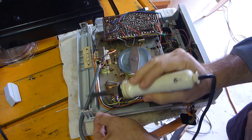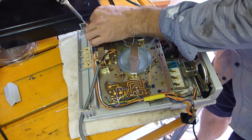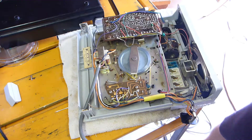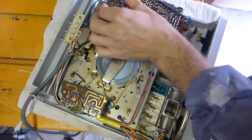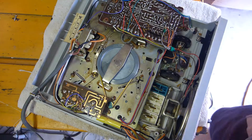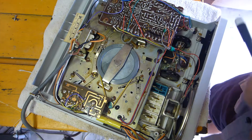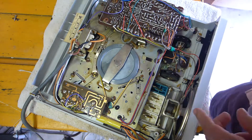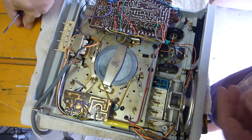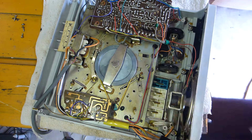You've got to unsolder these battery tabs — you could probably do it without taking these off, but this just makes it so much easier. The iron's still heating up so it's just a bit cold. What I recommend is to grab a Sharpie and put a little black mark on any screw that connects to the chassis, so you know you're screwing into the chassis and not replicating one of the screws on the back of the case.